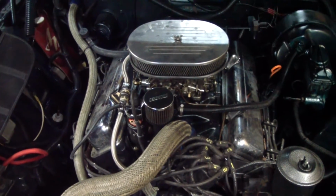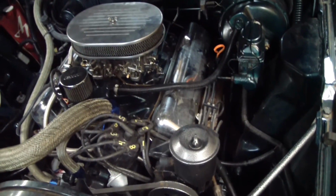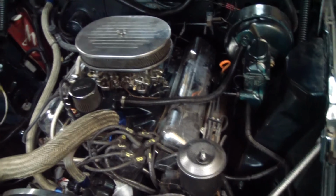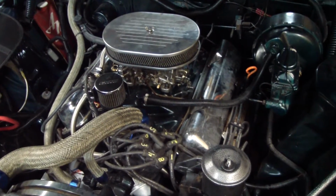We have searched for the numbers in the block, and we're not finding any. There's supposed to be 2-inch letters around the motor mounts. Looked all around that area on both sides and nothing. So we're thinking this is a replacement block.